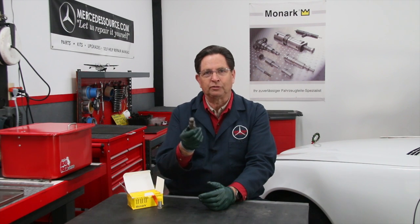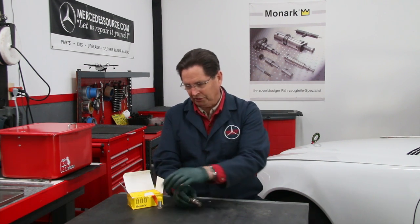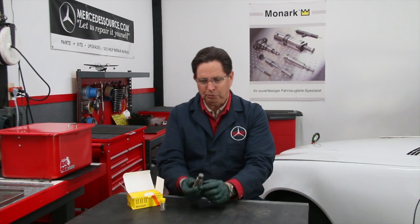But these can be rebuilt, and this is something you can do yourself. If you have a Mercedes diesel, a VW diesel, or any of these older diesels that use mechanical fuel injectors, the rebuild process requires a replacement of the nozzle, which I showed you earlier. I'm not going to go over that in this video — I have a number of other videos about rebuilding diesel fuel injectors and how to check them to see whether they're okay.